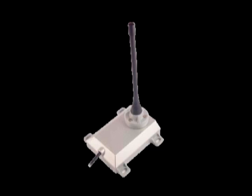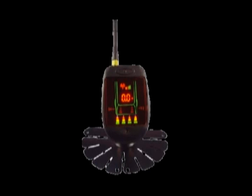Before translated information is sent to the driver, it needs to be sent wirelessly through the wireless transmitter. The wireless transmitter is encased in aluminum and has a 2.5-inch antenna sticking out to transmit the signal to the driver's display located in the cab. Located on the dash of the vehicle is the driver's display. This display has a 1.5-inch antenna which receives the signal from the wireless transmitter. The display is only powered on when your vehicle is in reverse and will give the driver the distance and location of oncoming obstacles.